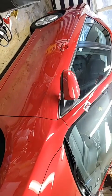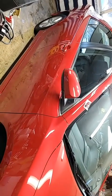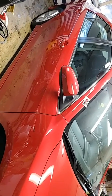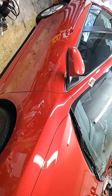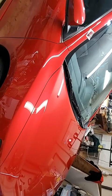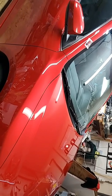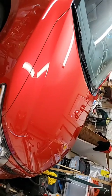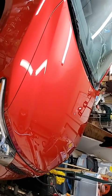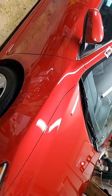Anyway, I did all that. I used the water spot remover on the entire vehicle after claying it and chemically deconning it. I still had to do the water spot remover on the whole vehicle — that was a real pain. And after all that, on a lot of this car I did what we call a one-step polish, but on other parts I did some wet sanding and a two-step polish.